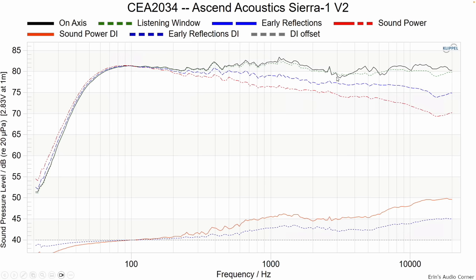In other words, I'm surprised that it's this smooth given how far apart the tweeter is from the mid-woofer below it. This is the estimated in-room response at zero degrees and at plus or minus 30 degrees horizontal in red — look at this, it's extremely smooth. I would consider this probably textbook. And then this is a comparison of the V1 in black versus the V2 in blue. With the V1 in-room, I would have said that the mid-range sounded hollowed out, with some boxiness around the 700 to 1 kHz region.